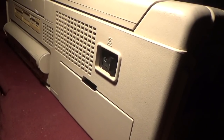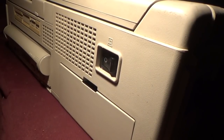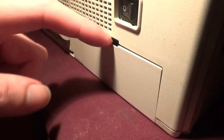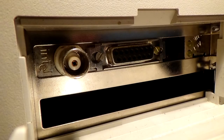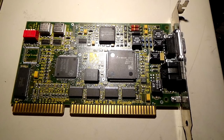Beyond this, there is a fan, a recessed power switch — so you're less likely to flip it by accident — and also there's this door. Like the T3200SX we looked at, this system has the ability to house regular ISA expansion cards. Both slots in this one are 16-bit, so you can put full-size 16-bit cards in here, which is quite unusual. This system came to me with an Ethernet card and also a token ring card installed, a consequence of what this system was being used for.